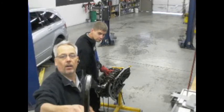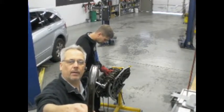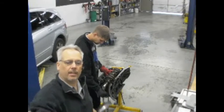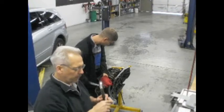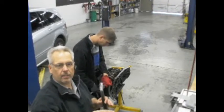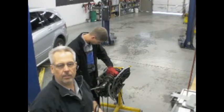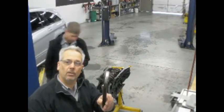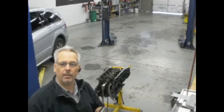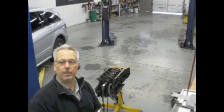Well, I would just be curious if that person, although in person, would have any idea how something like this could happen otherwise. It does have a ratcheting tensioner. It's very simple — when that tensioner ratchets out to its end, if you put a new chain on it without resetting that tensioner, you're going to have it over-tight, and that's exactly what happened. So I appreciate your comments, keep them coming — you can say all kinds of nasty things, it doesn't bother me a bit.